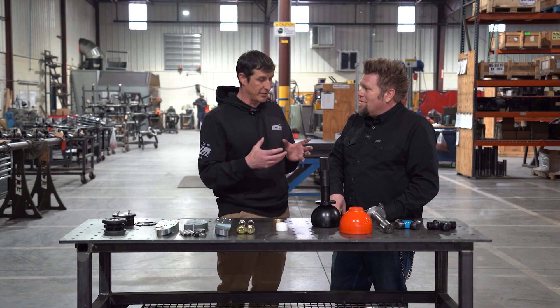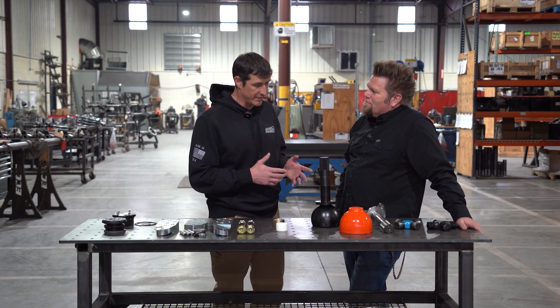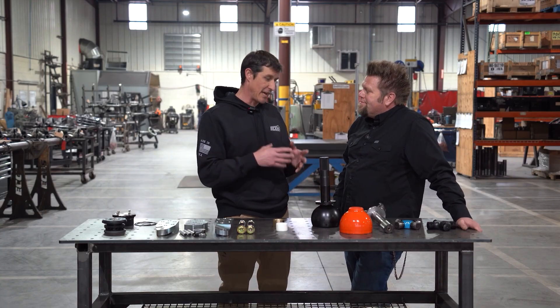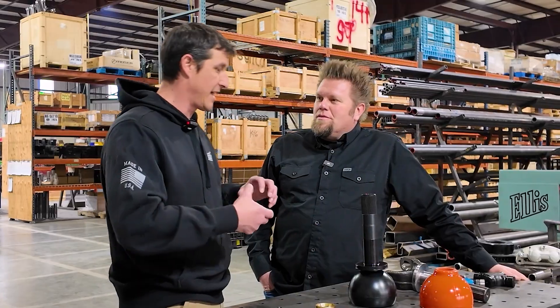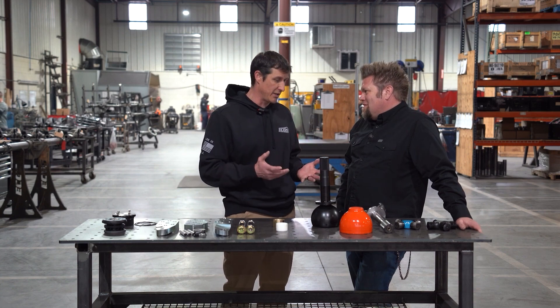RCV's big bell is a direct drive into the unit bearing, and I do have a little bit of issue with that. The 05-plus stub shaft is very short, so there's no torsional escape. Whereas when you get a longer stub shaft, it can twist in there. That 05-plus is very short, and when you shock load it, you can have some failures. So people say direct drive is great because it's gigantic — it splines into the unit bearing. But my issue and concern is that if you have a trail issue and something goes wrong inside the bell or the diff, there's no way to just let your tire free spin.